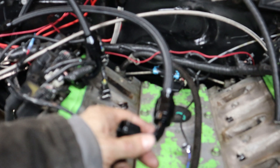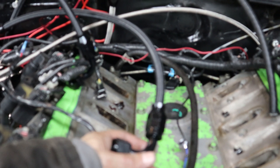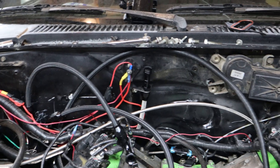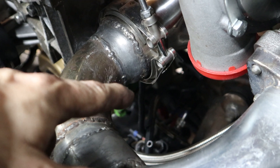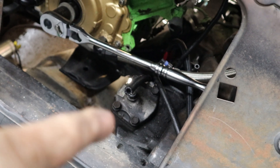I already put 90s on these — I couldn't remember but that works out great because I needed more. As you can see, there's the Y-fitting right there and these will go to the back of the fuel rail. That line coming up will be the return line. I still gotta get rid of the original stuff — the filter is still sitting up in there, still basically attached — and I gotta get rid of that because it won't be needed anymore. I also gotta put in a new manual steering box.